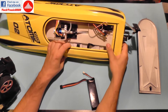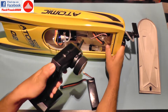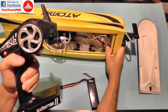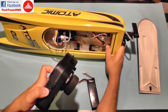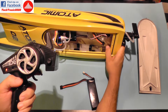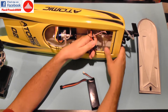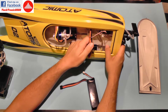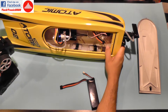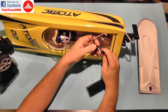The battery goes in the hull where velcro pads and velcro straps are pre-installed, making it easier to get started. Let's do a quick test to see if everything runs after its long journey from China. I'm going to power on the transmitter. I also found out that one button changes how the throttle and brake work — you can split it 7/3 or 5/5, giving better resolution at throttle or splitting it evenly with braking.